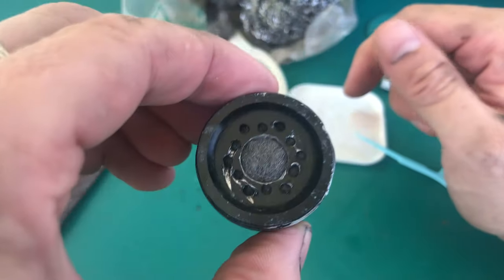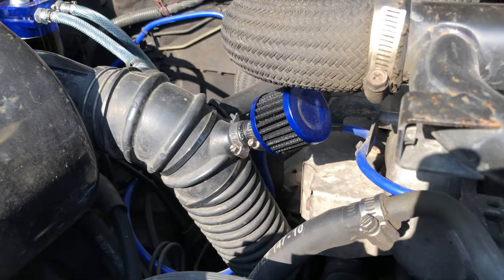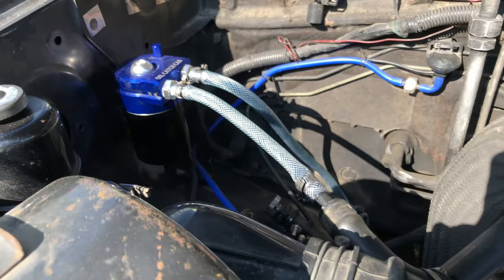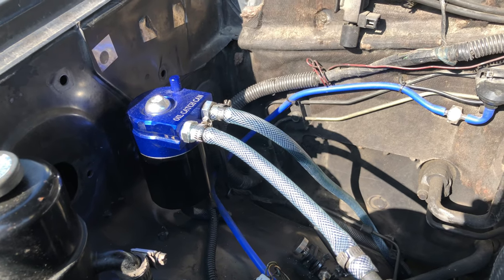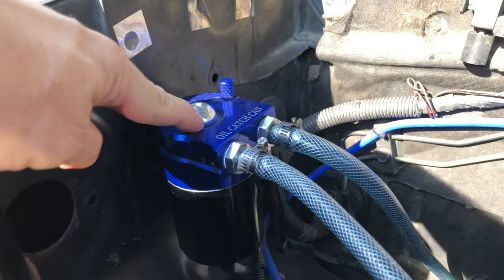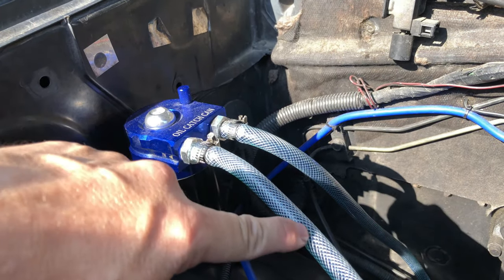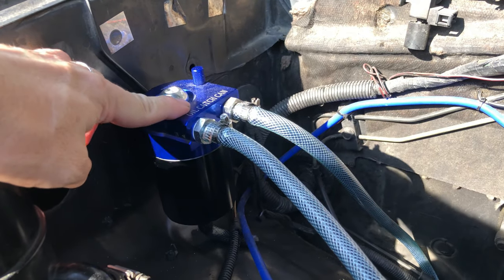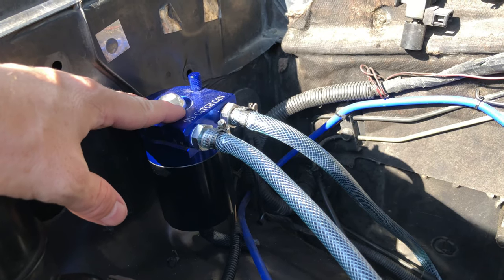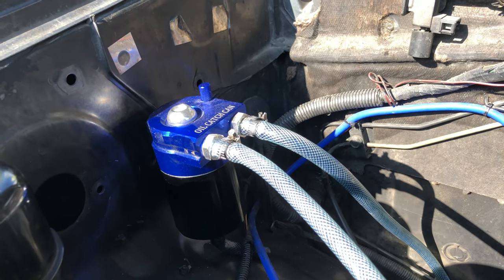I just want to show what the system looks like now. I put the filter here just kind of temporarily until I decide what I want to use to plug that. I put the aluminum plug at the top, and I did end up getting the baffle filled with finer steel wool than what I put in the can itself. Under this plug is the baffle — there's no more oil coming from this side anymore, so I'm considering it a success. The steel wool inside the baffle hasn't yet had a chance to get completely coated with oil, but once it does I think it's going to be most efficient at trapping the vapors. Another 500 kilometers and I'll do an update video.